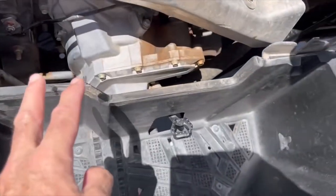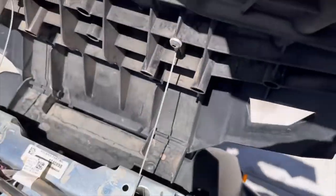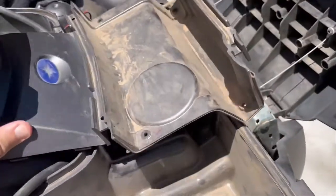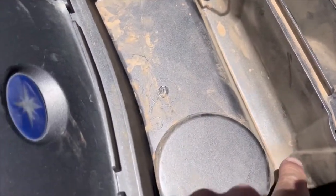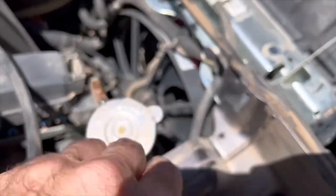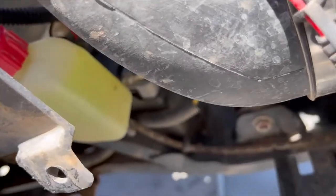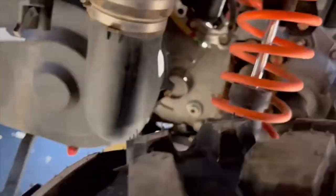So far we've got the oil filter done, new air filter, new spark plug, and oil service is done. We've also checked and inspected the radiator — you lift up your front cargo bay and there's a little access panel with four T25 torx screws. That's your coolant fill. We were full there but topped off the overflow reservoir, which was completely empty.